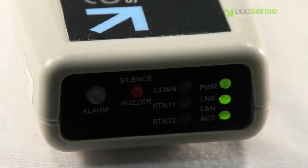This unit has a continuously blinking blue connection LED. It may or may not stop occasionally, then begin blinking again, but it never lights solidly. This is definitely a DHCP failure, and if it cannot be remedied by resetting the A2 unit, you will need assistance from an IT professional.